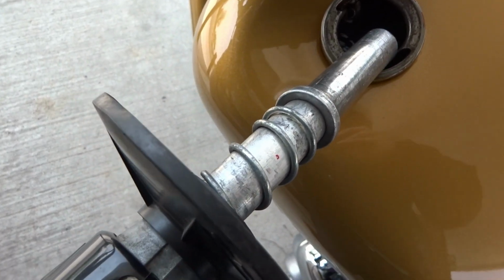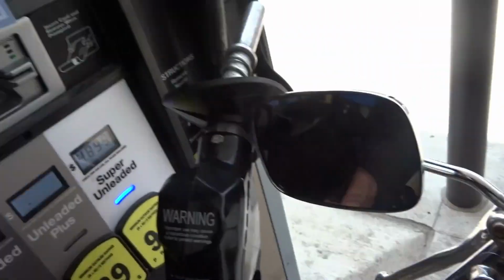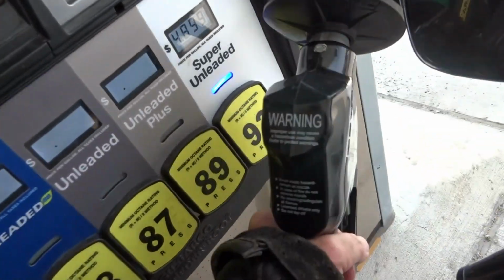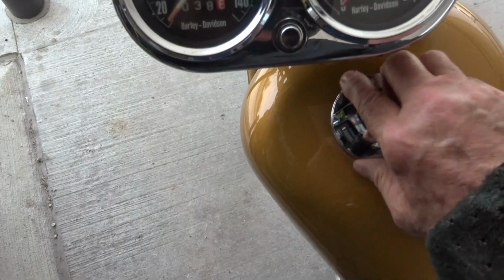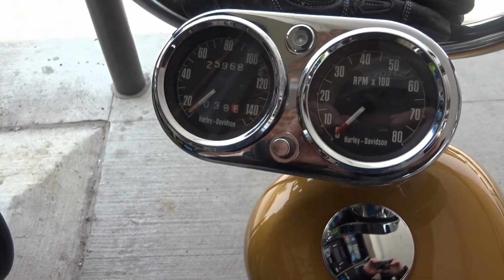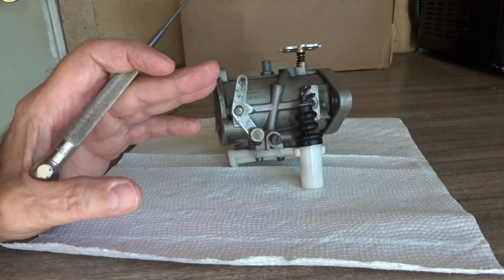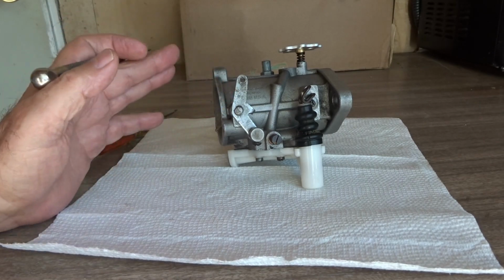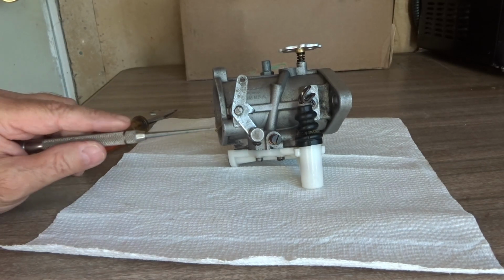Where you are getting optimum burn at your spark plug, where it's not too rich, it's not too lean, because you can go through all your gears under full power, under full load, and you're getting full power. Yet, it's running lean enough to where it is really under a clean burn, and where it's not too rich, where you're wasting fuel and fouling out your spark plugs. At this juncture, we came off the lean side until you just got enough fuel and you left it alone. We were working with only very fine 16th increments to the rich side going from the lean side.